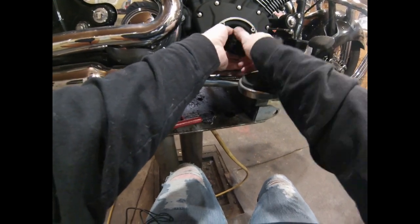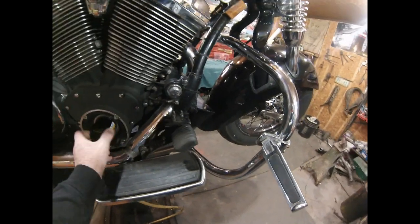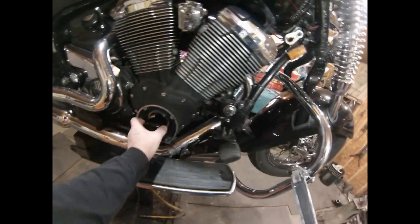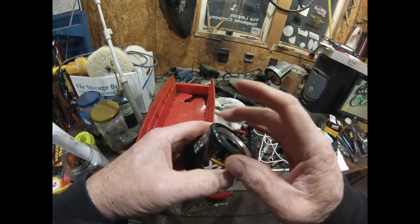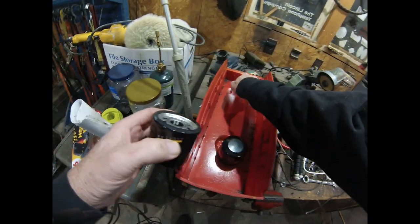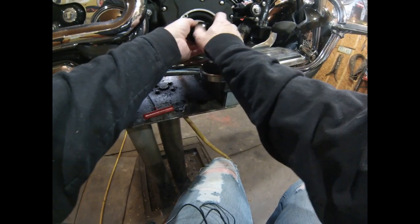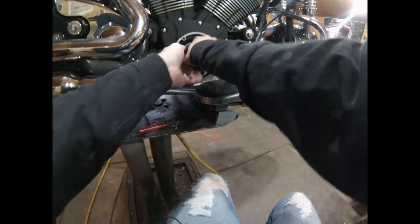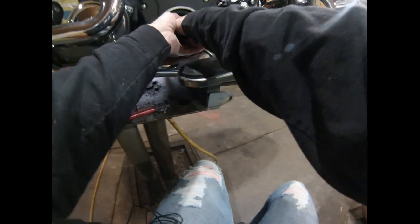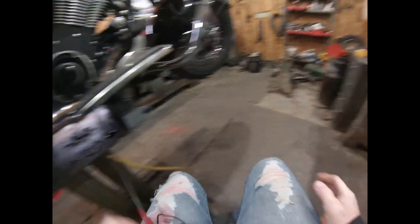I have put these on before and had them weep a little bit, and then I had to pull the cover back off and re-tighten it — and I did the biggest no-no of all: I didn't put any oil on the seal. I like getting a little oil on there because these sandcast blocks — actually any motor, but sandcast blocks especially — seem to absorb the oil. If you put a seal against it, it really locks up hard. In a previous video I talked about how hard some of these bolts come out, and I believe it's because the sandcast just sucks the oil away from them.